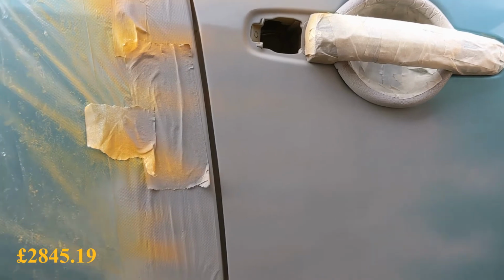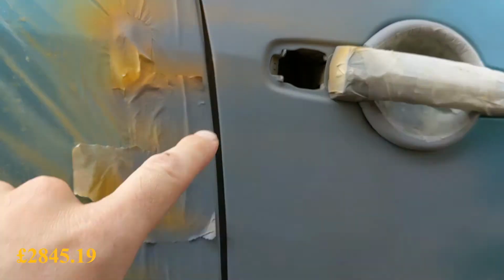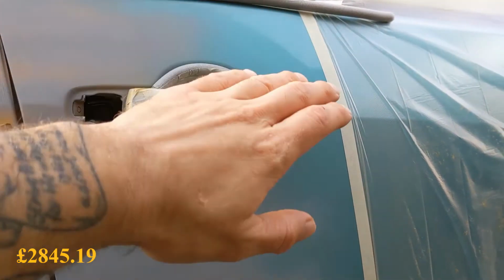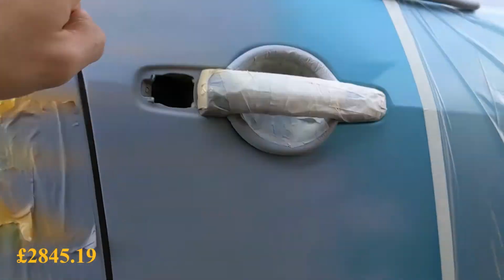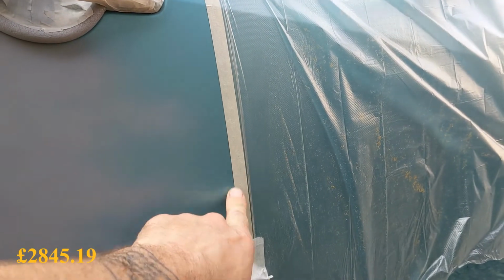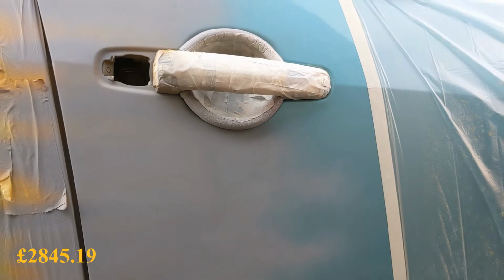First coat of primer, you still see some of the filler primer underneath. Yeah, second coat of primer, then we're going to 1200 all this area. I've got some of this sort of wind proofing, I think, for doors. Just makes, you know, a nice round edge rather than a sharp masking tape edge. Yeah, hopefully it turns out decent.